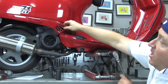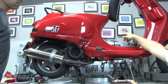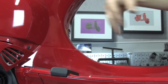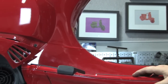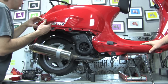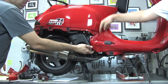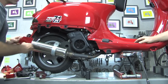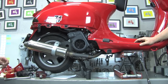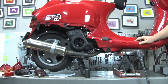Now we'll talk about removing the side fairings. First, there's the engine access door up here, which comes out with a simple screw — take that out of the way. Then move to the rear half of the bike and remove both skirts; they have two fasteners each. There's a single fastener here that you pull away. Oftentimes the fasteners are rusty — a good time to change them out. We carry those in stainless and original black oxide.